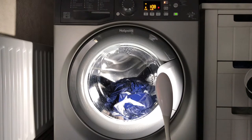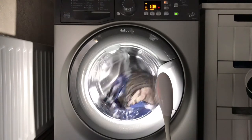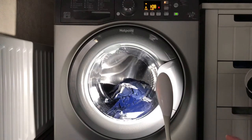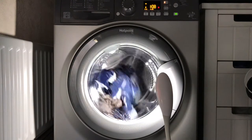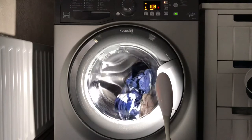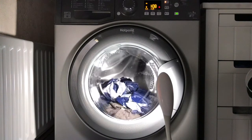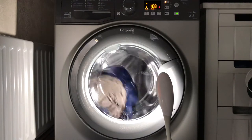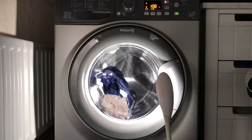No fill topping up again, one hour eight. It does about five minutes of these slow tumbles and then moves on to fast tumbles. This doesn't sense at all — these are just normal slow tumbles. If the program were sensing, this icon would flash, but it doesn't. So this program does not sense the load. The levels and operation are the same regardless of what you put in.